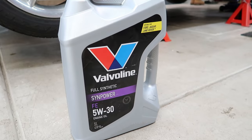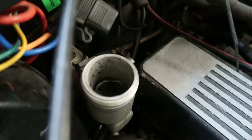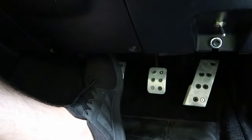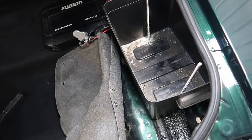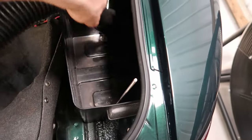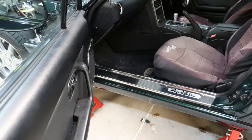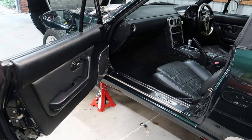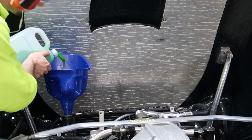I'm using the oil which was recommended by the previous owner, but I'll soon find out that it pays to do your own research. The clutch fluid looks very old so I'll replace that now and come back to the brake fluid later, as I already plan to upgrade the brakes. Using a one-bottle method I can pump the brake pedal and watch the magic happen. The battery is surrounded by corrosion and needs replacing, so I'll upgrade to a bigger battery — in future I plan on having a working sound system. With the engine cooled I rip out the smelly seat covers and give the interior a quick once over. Much better, and good to see the seats are in better condition than I expected. Lastly, I can fill up the coolant — but this wouldn't be the last time I'd have to do this step.